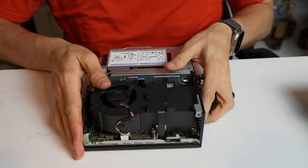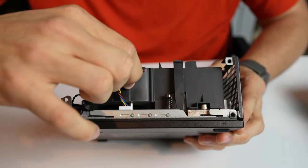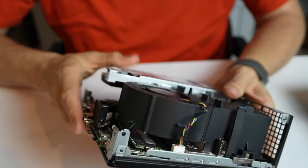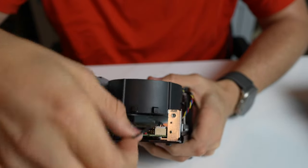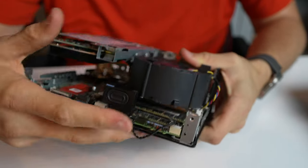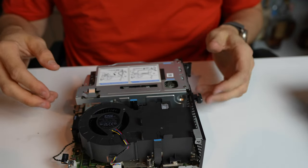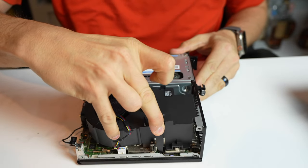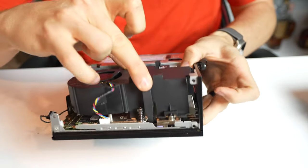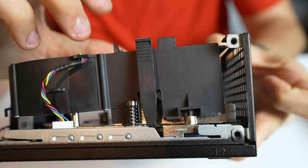One is this fan cable. So you're just going to route this kind of around through here. And then there's also another one on the back. You're going to take this cable and move this guy out of these little notches. So it's very simple. Not too complicated here. So really, next steps is we're just gonna pinch these two here and it's gonna lift off the heatsink. Now if you see, there's a little keeper right here. This just pulls right off. There's nothing else you have to unscrew or anything.